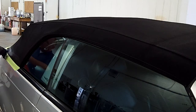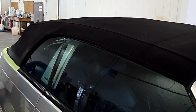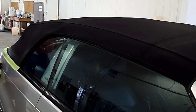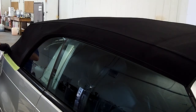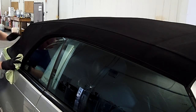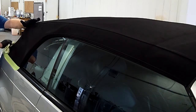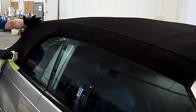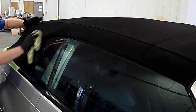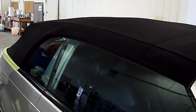On some of the steel sections of convertible tops, be careful when you're applying this — it can take some of the lubricants out of the hinge points. So if you're going to soak it down, have a little look. You'll see that on some German products where they've actually got an insert underneath the canvas of a piece of metal — it's kind of a pre-fully-retractable metal roof, and you'll see that on something like a CL. So it's just something to watch for. Each brand's a little different, a little tricky.